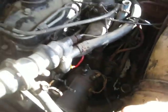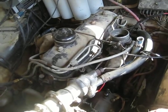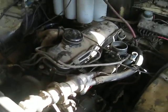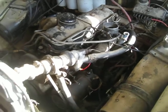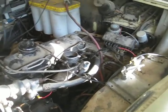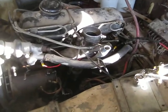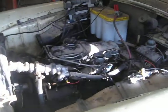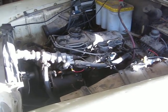But you know, I had three of these diesel pumps and all of them didn't work, so I sent two down to the diesel shop. The first guy said the first pump was junk, or just there's better ones. You can build anything. And then the second one works. I mean, the car starts and runs now, but I got these Monark pencil glow plugs versus the other Bosch style, and it fired right up on the Monark plugs. So that was really a big deal. And so I guess the next thing we'll do is resolve the water leaks and the oil leak. But it fires up, man, which is unbelievable.